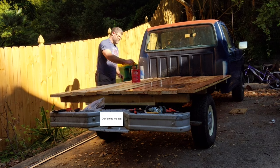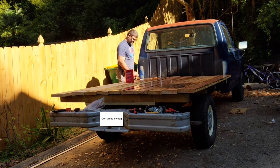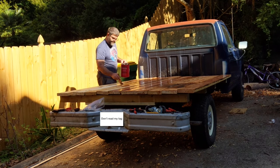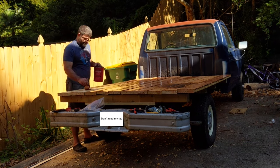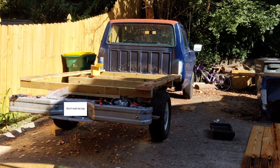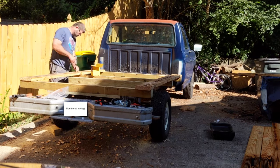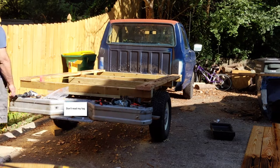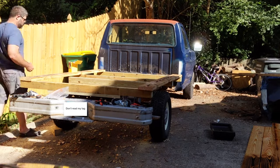This was important because I discovered I didn't really like the pink hue it gave to the wood. I thought it would be kind of a mahogany look, but it was just pink, so I addressed that a little bit later. But pink or not, it was important to give the bottom some protection. I got one end piece nice and square to the body and screwed it in with coated deck screws. My plan was to attach both sides and work my way to the center. That way, if I had to fit the center board or the two center boards, the bed would still look symmetrical.